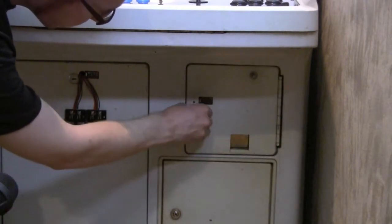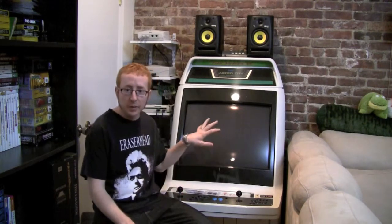And that's how you do your coin insert. So that was a quick look under the front panel — the general monitor adjustments, how to hook up the buttons, and how to wire the coin insert button. Now if you're having more problems with your monitor, there are more adjustments on the monitor board itself, but you have to access that from the back side. I would not recommend touching any of that unless you know what you're doing, because you can get shocked, and I've heard it can be fatal. There's some disagreement about that, but in any case you can get hurt. So unless you know what you're doing, don't mess around back there. Those should cover most of the monitor adjustments you need.